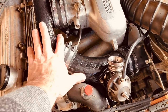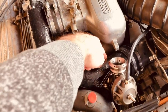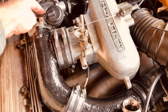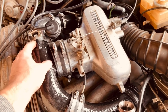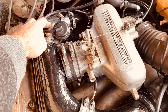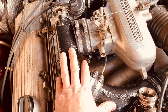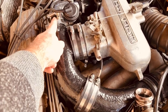Another very important aspect: these two components get replaced. The original kit had a 40 millimeter pipe coming out here and going there, and the bypass valve was crammed in and connected with that pipe. The original kit came with a valve flange with three bolts that allowed a 40 millimeter hose to be clamped on. You don't need that part anymore, and those three bolts should not be reused — they're either too short or too long for the upgrade package.